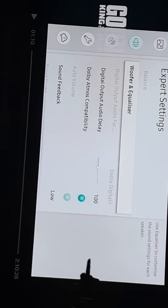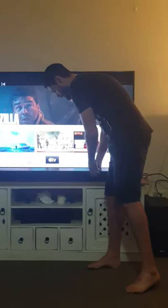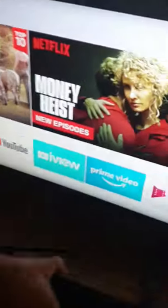Now this is the fun part. I've also switched out the cord from the DVD player on the back of the HDMI. Basically, from the TV where you have HDMI 1 in the back, that normally goes straight into the DVD player. I've actually already pulled that out. So what you're going to do: HDMI 1 goes into the back of this soundbar instead.